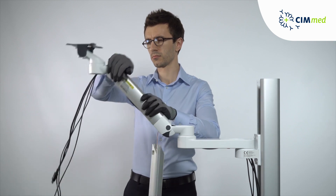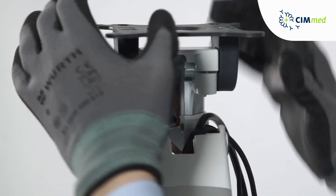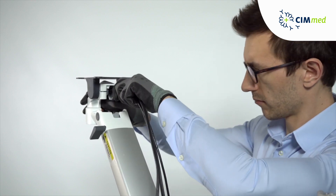Bring the arm to its highest position. To pass the cables through the front swivel part, turn it 180 degrees inwards towards the rear end, so that the two cutaways line up. Push the cables through into the back and clear the front rotational piece.